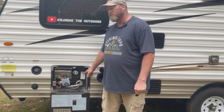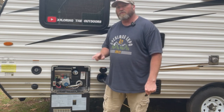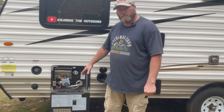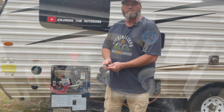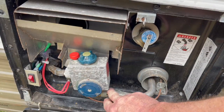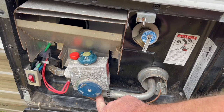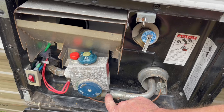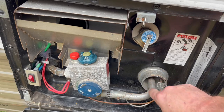So we just got to blow that tube out and clean it out. I'll light it real quick and show you what it looks like, then we'll let it cool down, get the tools out, and get ready to clean it out. Here's a quick close-up: this right here is where your oxygen gets sucked in, and the gas comes through this little brass piece. The oxygen gets sucked in through these little louvers right here and it shoots around and blows out that way like a blow torch.